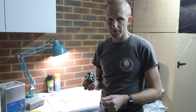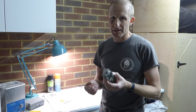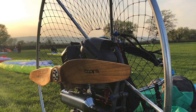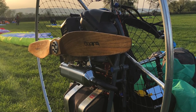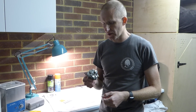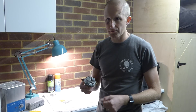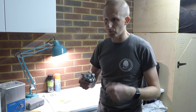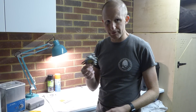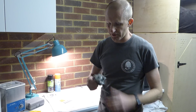To confirm there was an issue with this carburetor, it's exactly the same as the carburetor I have on my Bulldog Polini paramotor, so we swapped the carburetors over to see if this was the issue. Sure enough the motor started fine, warmed up fine, and wasn't showing the same issue — so we've isolated it to the carburetor.